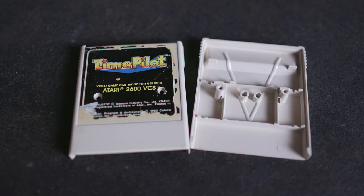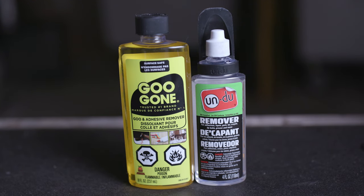The tricky part with Atari labels is that they're put on with a kind of glue that after 40 years tends to dry up like concrete. Atari cartridges stored inside at room temperature in a dust-free environment, like a shoebox, are going to have softer glue and you're going to have an easier time removing those. But Atari cartridges that have been stored somehow under some stairs or in a wall, only to be discovered during a home renovation and then power washed and then kept God knows where — those Atari cartridges are going to have hermetically sealed glue on the back of their old labels. It's pretty tough to get that off. I asked around, did a lot of research. The going theory is that it's probably an acrylic glue on the back of these labels. I wasn't sure what would be the right solvent for that. A lot of people use Goo Gone. I tried a bunch of solvents.